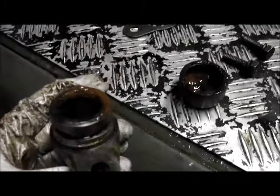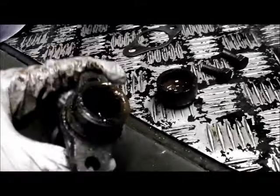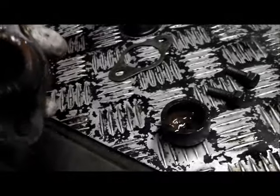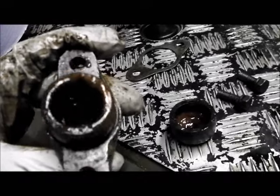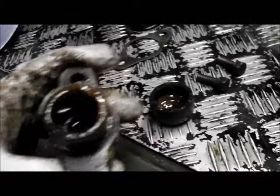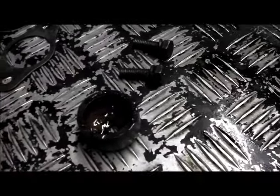Here we are - that is exactly what you don't want to see. It's a good job we're changing this really. That's water that's got in there. What you do is pack that full of grease when you put the new one on - I've already done that. The water can end up in the fluid. Clutch fluid - and brake fluid as well, same thing - actually absorbs moisture. So that is the result of not maintaining the vehicle properly.